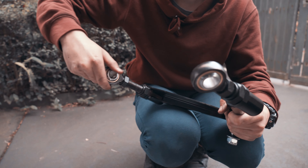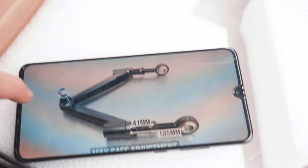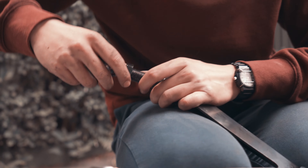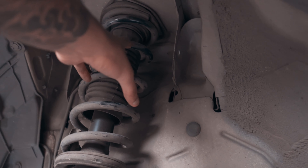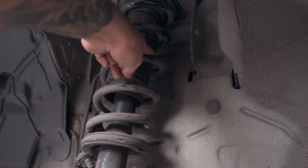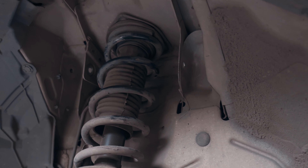I've seen it stops. This comes out — what was it? A hundred and five — 105mm from the inner bearing to the bottom of the nut. Because of the spring we can't get this bolt in, because that bolt goes on an angle. So we're just going to take the whole strut off, or at least lower it, to get some clearance to fit the bolt in. Should be good.